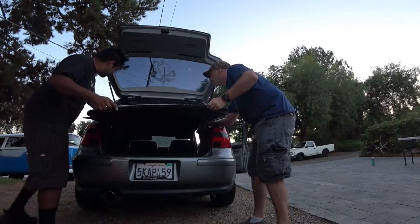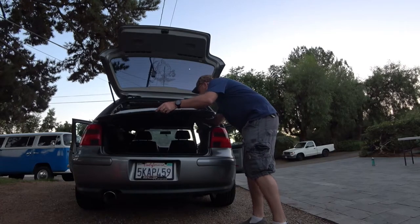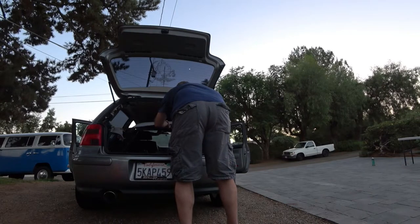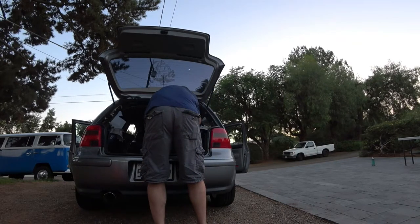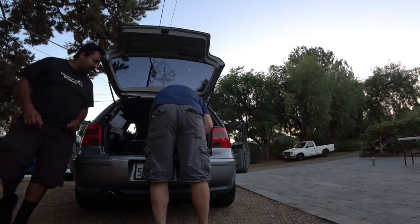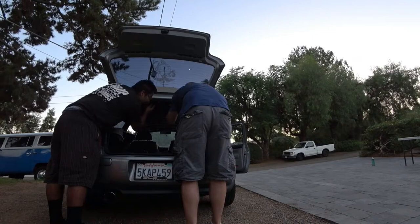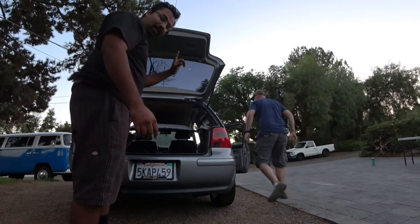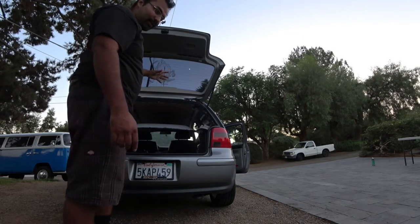Make sure it goes over the seat. Let it sit on your mirror. So you want the headliner to sit on the rear view mirror on the front, while all this is going. You can let it drop down right here. So the next thing you guys are going to want to do is first do the handles, then do the front screws, and then once that's all done, you put your pillars in.